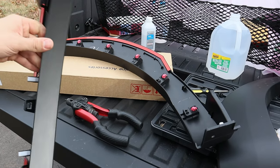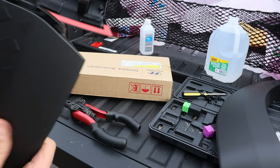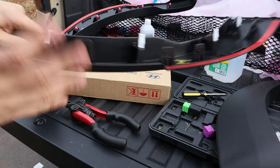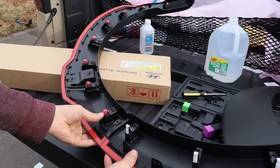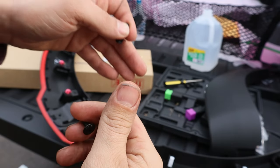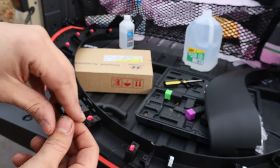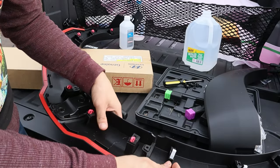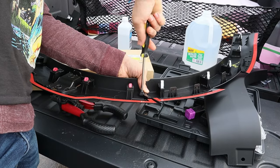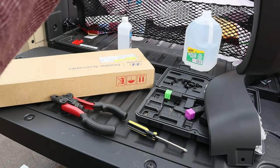Here's the other thing. So, this front flare has this attachment, and what they want you to do is, here's the back attachment. They want you to assemble these two pieces together and insert a Phillips head screw, joining them together. Take a coarse threaded nut, and we're gonna screw that together. The coarse threaded screw is gonna go into the fender flare, and the fine threaded bolt is actually gonna go where those riv nuts got put. So that's right there. So those will stick together.